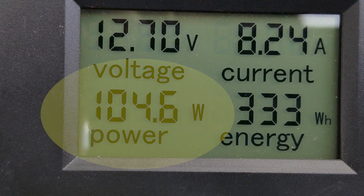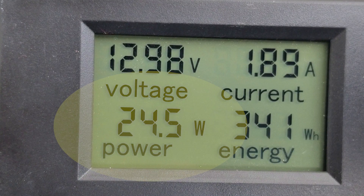That's 34.3 amps. Once we changed all the bulbs to LED, we ran all the lights with no other systems, and we dropped down to 104.5 watts — that's 8.2 amps. Even more dramatic: we turned on only the lights we'd need for playing games in the living area, and we came in at just 24.5 watts to light the entire living area. That's only 1.9 amps of draw. That's amazing.